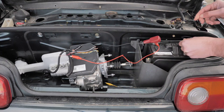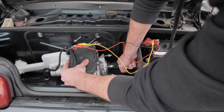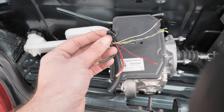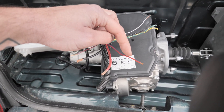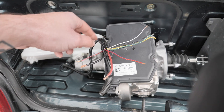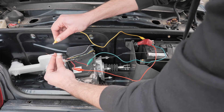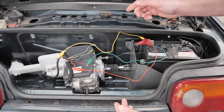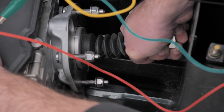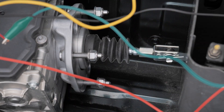I should remind everybody that I still have no idea what I'm doing, and surprise, surprise, something wasn't working. I did some YouTubing and I found out there's one more wire that you need. It's not just three. You have the two biggest ones that go to the positive and negative of the battery. You have this one that is toggled by the key, and then you have this one, which is the second thickest wire. This one is the ECU that controls all this stuff, and so that one needs 12-volt power too. I don't know if this is a Gen 2 iBooster thing where you need the ECU wire to have power, or if SuperFast Matt was just keeping secrets. It made noise, which means it's working. And now the brake booster has power. So awesome. This is going to be cool.